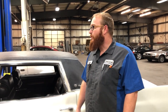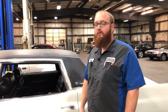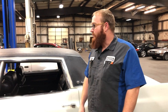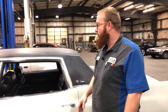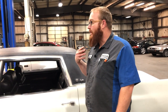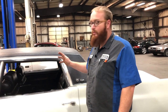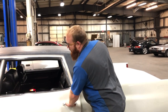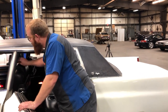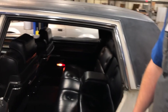Check along the whole chrome strip on both sides for rust bubbles, Bondo work, or anything like that. On the front, just make sure it hasn't been wrecked, the grill is in good shape, and the headlights are straight and not broken. Those are the telltale rust areas on these cars. Next, the interior — another area I'm not great at. I can fix mechanical stuff, but I want the interior and body to be decent. This car has 96,000 miles on it, and the interior is immaculate.